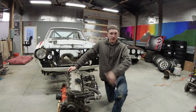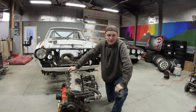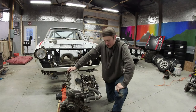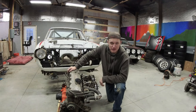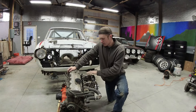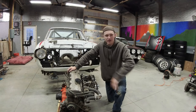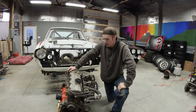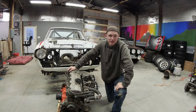As far as engine upgrades, I honestly have no idea what's done to the inside of this engine, except that it sounds like it's got a 3/4 race cam, and it's got twin Mikuni Solex side draft carburetors on it. These are a must for waking up one of these little four cylinders. I've got a header to go on it with some pretty small pea shooter runners. Otherwise, for all I know, it could be a stock bottom end engine, which is probably my best bet.